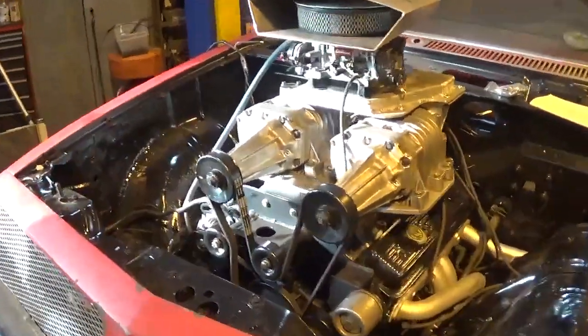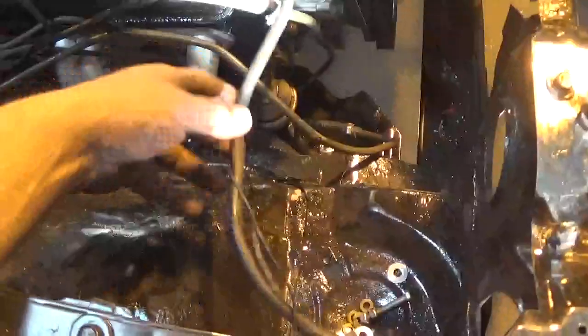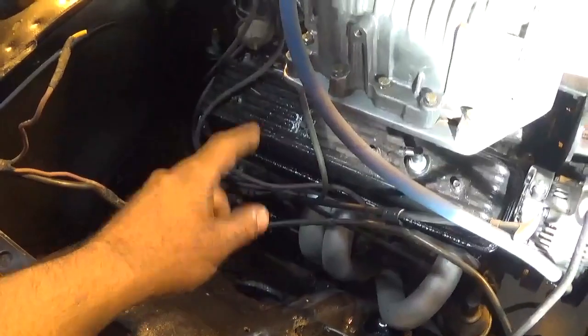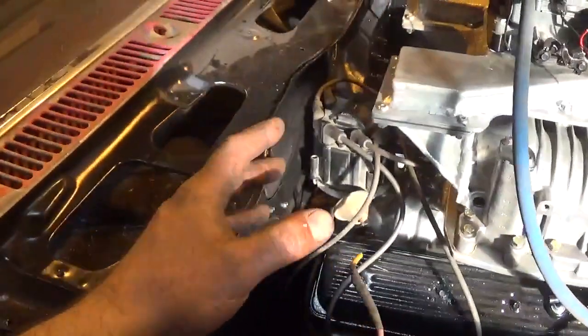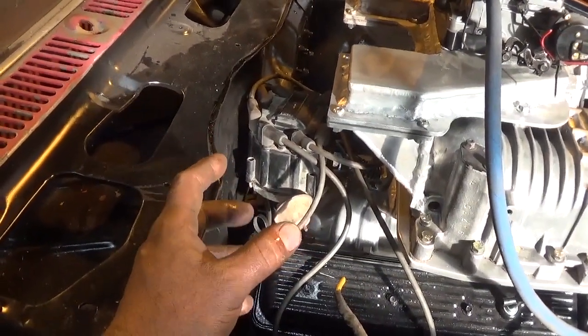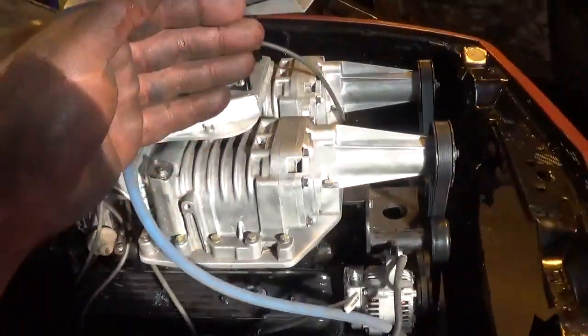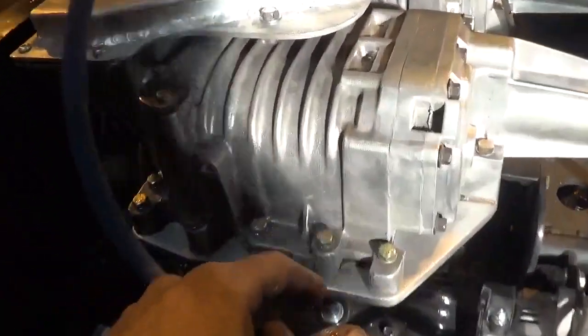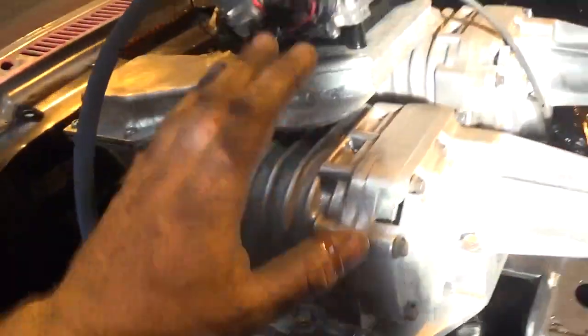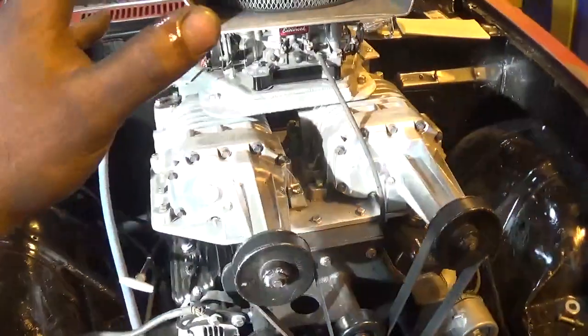Everything's sitting here ready to go. I have my fuel line crudely hooked up just to see if we can get some gas up here and if it runs. Got my hot cable and my ground cable here. We're just going to toss a battery up here with no tray in it, and I'm going to run a jumper wire off the starter and off the distributor. Put the distributor in last night - it should be really close to zero, pretty much right on the head. Might have to throw a little advance at it. We did prime the oil pressure already and rotate the motor over, so everything should be pre-lubed, and we filled the superchargers with their oil. Made the cork gaskets, so all this stuff should be ready to roll. There is actually a little fuel in the carburetor right now too, so maybe it'll start right away.